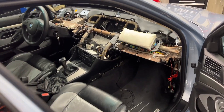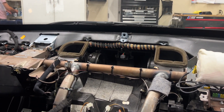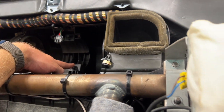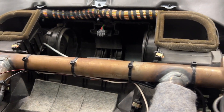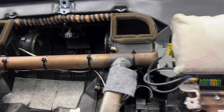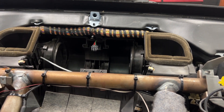The blower motor on my car hasn't been out in nine years and it's a little whiny, so it comes out. That was a bear to get — I got it from ECS Tuning back in the day. Had the new genuine BMW blower motor, started and intended to finish the job today. Put it in — three Torx bolts — fired it up, super nice and quiet. Raised the fan speed to about setting 14–16 out of 16, and it gets really loud as the fan blade goes totally lopsided and starts hitting the housing. They didn't balance the fan blade at full tilt, or the balance weights fell out. Having another unit sent — due Thursday.